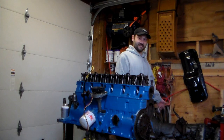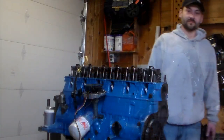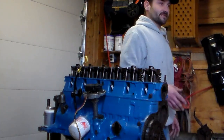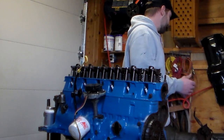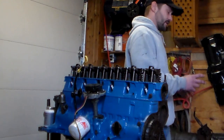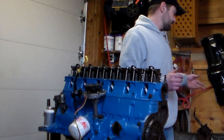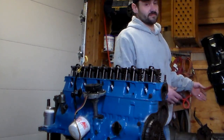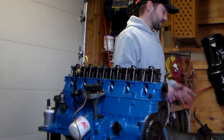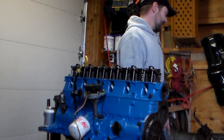which you can't really see, it's down here. Either way, that has to get gone through, all the seals that are possibly leaking, any of the joints between the transfer case and the transmission. I want to make sure everything is sealed up. I don't want to have any issues. I'm going to check the chains inside the transfer case just to make sure that everything's good on the drive chains. I don't want to have any slapping or anything.